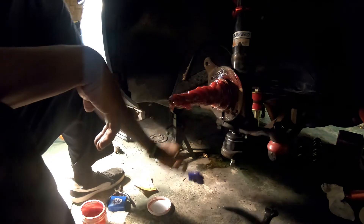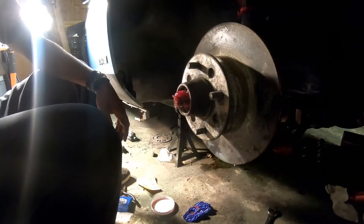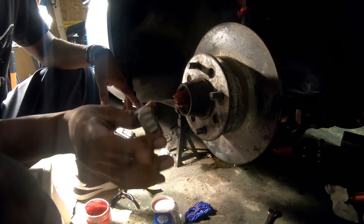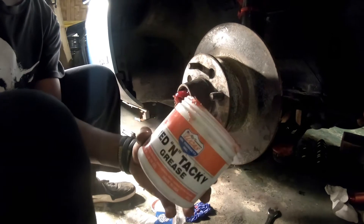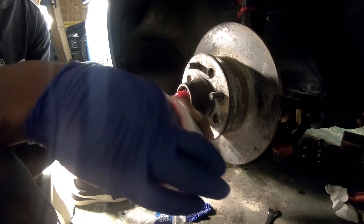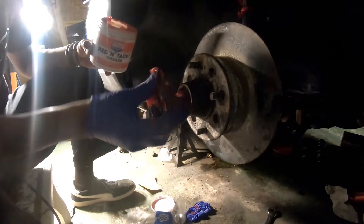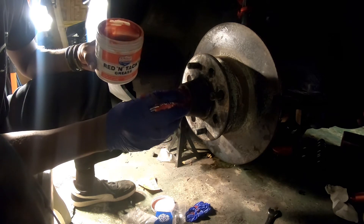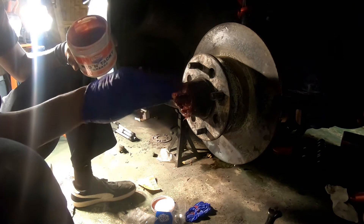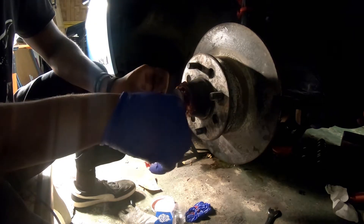That's all greased up. Now we're going to grab our wheel hub and try to put it on here. Get that nice and tight — you should feel kind of a squeeze back there. Then grab your front wheel bearing and get another glove, because we've got to grease this up. Take your bearing and move it all around in there — nice and greasy. Take this, go over top of this — it might give you a little resistance but make sure it goes all the way in. Get more grease in there, wipe it around. This little washer I just washed — put that over, there's a little groove that's gotta follow the thing.